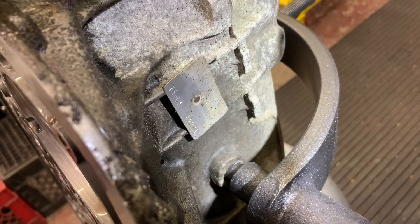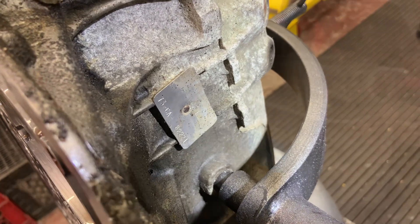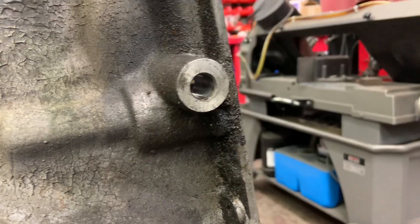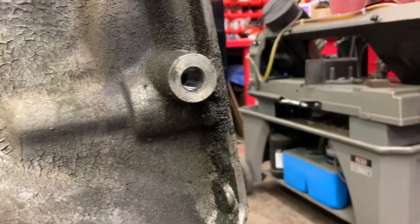What makes it really unique is there's no linkage seal — just a machine boss and an O-ring on the shaft. I can't tell you the last time I've seen one that just had an O-ring in 73. That is a weird case right there. That's the code, 73 CA. And that's where the recess for the linkage seal should be. Instead, it just had an O-ring on the shaft.